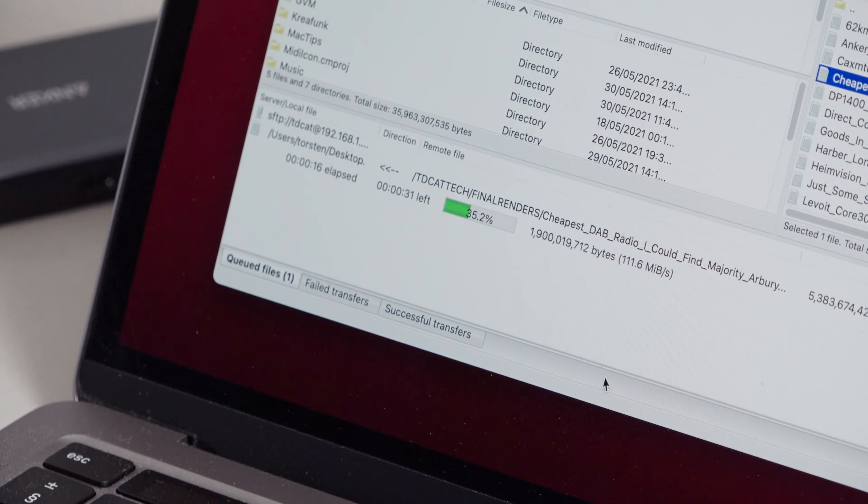This one comes in at about £50. You can get hubs much cheaper than that, but this is the one that worked for me around connectivity. With hubs, they're very much of a muchness — they probably all use similar chipsets. The Ethernet on here is still just Realtek gigabit Ethernet, probably the identical board to the one in the dock. But it works absolutely perfectly. I get a solid 112 megabytes per second downstream from my NAS on the gigabit Ethernet port. 4K display works absolutely fine.